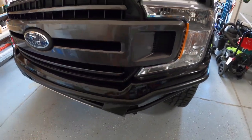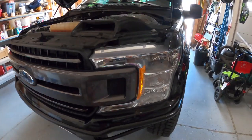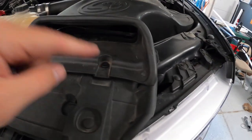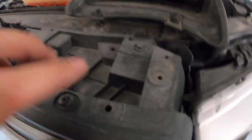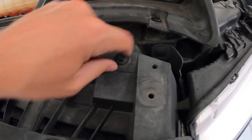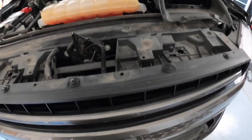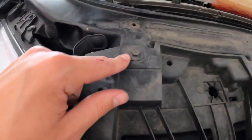We're going to have to figure out how to take this off — there's a few things we need to do to get the whole grill off so we can access the horns and make this change a lot easier. Step one: get off the rubber thing after taking all those clips off — it just pulls right off. The next step is one, two, three, and four bolts we're going to release so the grill can move more freely. This looks like it's probably some 10 millimeter.